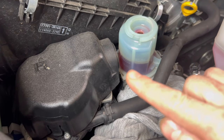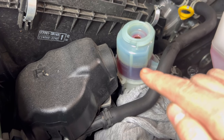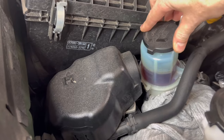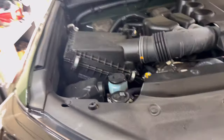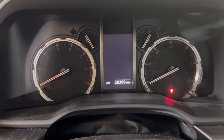As you guys can see, to the left of your reservoir you have a little low and minimum, and then another — this is hot, this is cold. I filled it up to the top on the cold side. Chances are I'm going to need some more, but let's go ahead. I'd like to do this with the reservoir closed because it prevents any over-spilling as you turn the steering wheel. Let's go ahead, start this car up, and I'll show you exactly what it's going to take to get this air out of the system. I'm doing mine a little prematurely, but that's a telltale sign of when you should do it. 30,000 miles is a good time.